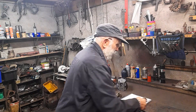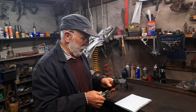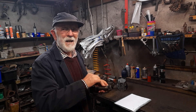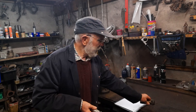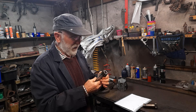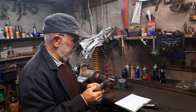The pinion I showed you is a brass one, and they are ideal — brass is very reluctant to wear, it's a really amazing material. It means that any wear takes place on the pinion and not on the starter ring. If you wear your starter ring you're faced with a much bigger problem. This is a steel pinion, becoming more popular simply because the brass ones are harder to get and more expensive. The steel pinion works every bit as well, but you need to make sure it's engaging properly and not out of alignment.